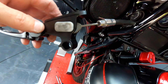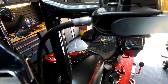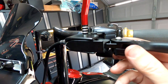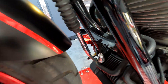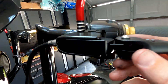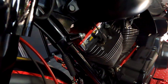Once you're done, the nylon piece is in place and the cable is attached to the lever. The lever assembly is back on the bike — it slid in real easy with all that slack. Here's the pin, just pop that down. Don't forget to put the clip on the bottom of both the clutch and the throttle. There's a bunch of free play because I need to tighten the cable back up — I'll screw the adjuster back out to about where it was, about one inch of thread showing.